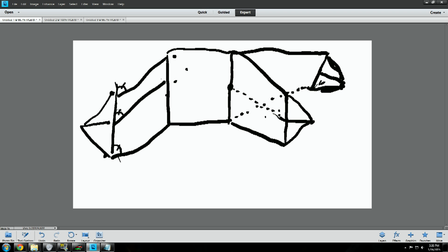Another little tip and trick that I like to use is I will actually include a shock over the hydro on the steering axles. That way, if you do get any speed wobble at high speed, it minimizes it and keeps it from happening. So you have your hydro coming down here, right? You also have your shock laid right over the top of that hydro. Just because there's a hydro there does not mean that you cannot put a shock going over it.